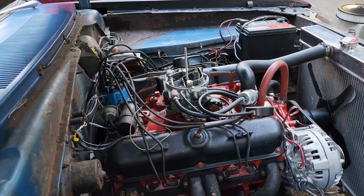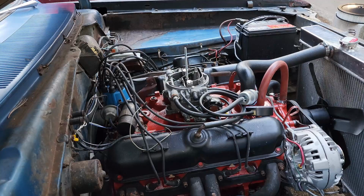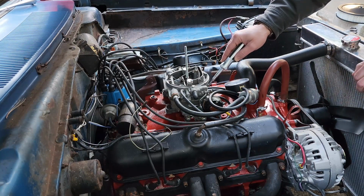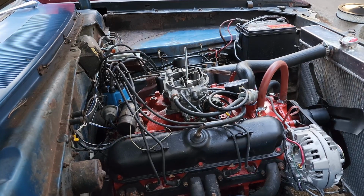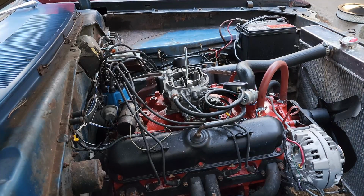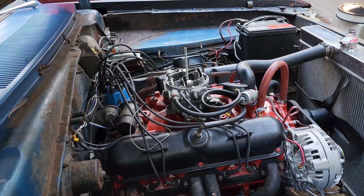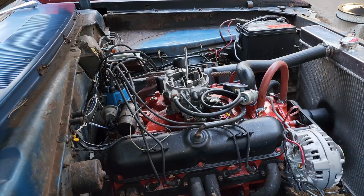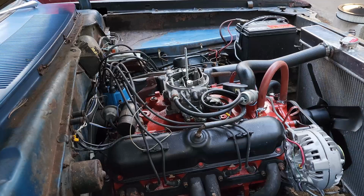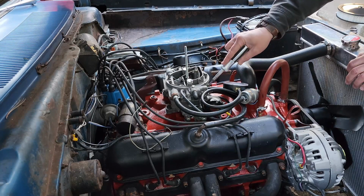It is at this point that it begins to dawn on me that I have this exactly backwards. I am not getting enough fuel. After one more test start, I turn the idle mixture screws out to 2.5 turns and gave it some more test runs. Okay, it's working better. A little better anyway. I am now setting the idle mixture screws to 3 turns out. Let's give it a little more.